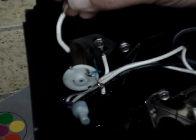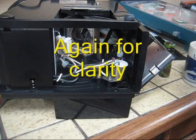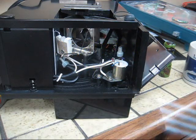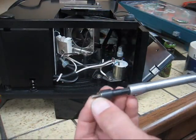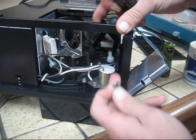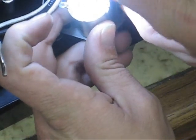Now it's time for the lower one - same thing, just stick this together and get in there. It helps to lay this on its top upside down. It's actually harder to keep these wire clips on here than it is to get the bolt in. It helps to have a magnetic screwdriver, and this one's obviously hard to see because we're going to be installing it right back here. Take this, put the bolt and the wire through, keep my finger on it. The gear can very easily drop off, so let's get that sorted - make sure that's on there.